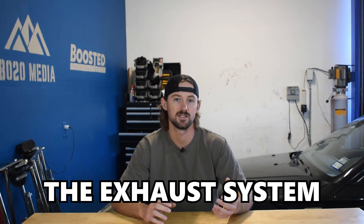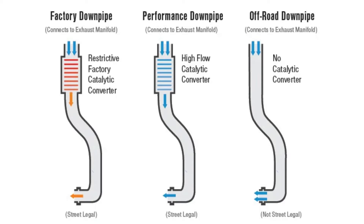After an intake, we recommend a downpipe. A downpipe is going to be the most restrictive component of the exhaust system because it bolts directly up to the turbocharger. It's restrictive because the factory downpipe has the catalytic converter in it, which creates a lot of exhaust back pressure. That back pressure acts as a force against the turbocharger — it's going to slow down turbocharger spool and require the turbocharger to work harder to achieve higher boost levels. Reducing back pressure takes the stress off the turbocharger and allows it to spool and spin more freely, which improves its efficiency and unlocks power gains. A downpipe is also beneficial from a reliability standpoint, helping improve the longevity and reliability of the turbocharger itself.